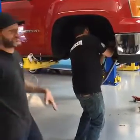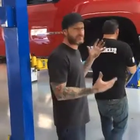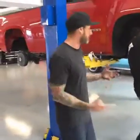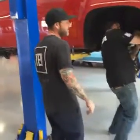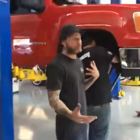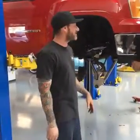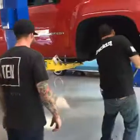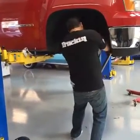And that's the cool thing about this kit. You don't have to change the spindle, you don't have to change the spring, you don't even take the strut out of the truck. So you're not compressing the spring to take the strut apart. It's a really simple deal with an upper and lower control arm only. It's as quick as you can unbolt all the bolts and slip them back in, which sometimes can be a little bit of a challenge. I like putting the grease in, but it adds my own challenges here. But it's worth it later on.